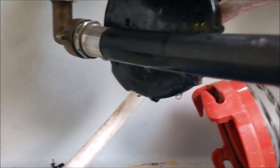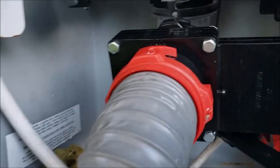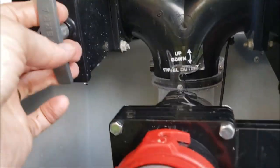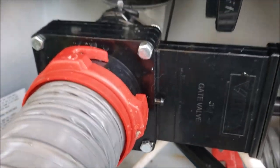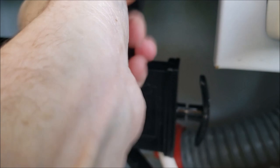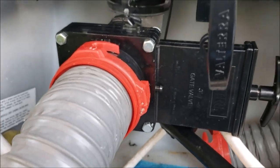For the test: the hose is hooked up underneath here, running wide open — the black and gray are both shut off so it's just going up and running right back down to the sewer. I'm going to open up the gray, now close this — there we go. The gray is open and the water is being forced up into the gray tank. I'm also going to open up the black so we'll have water going into both. Let's go up here and see what my lights look like.